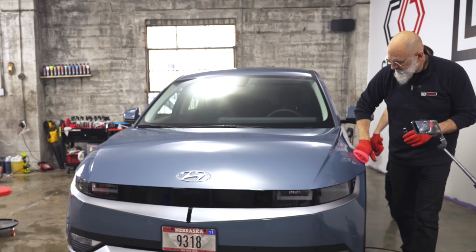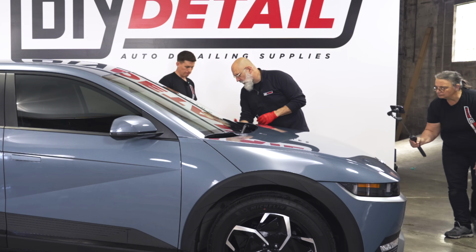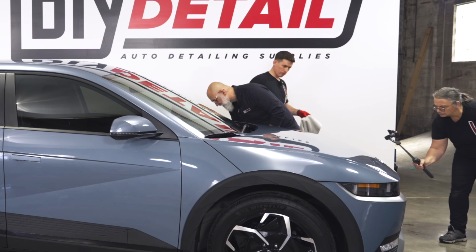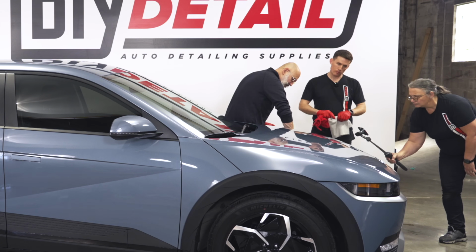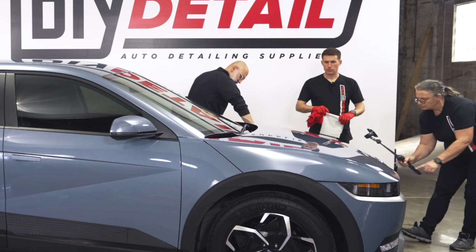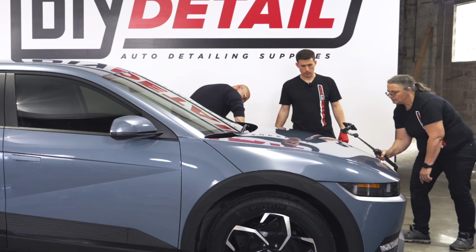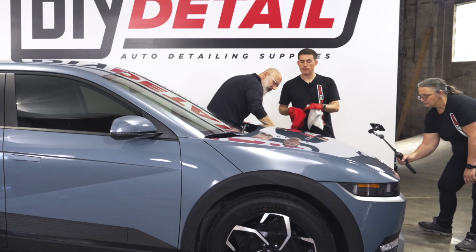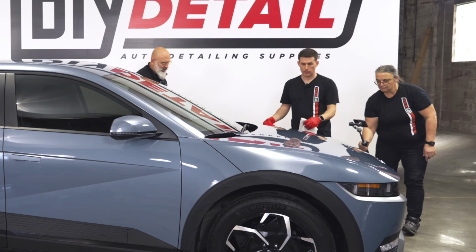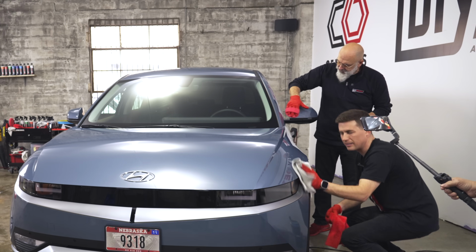And you're purposely going to overlap panels, and I know that about you and how you apply. Definitely. We want to overlap because that overlapping ensures that we haven't missed a spot. And when you're leveling, you also want to overlap. That way there's no spots missed. You can see that rainbowing on the surface, and we're watching for that to evaporate by about 50%. That's called flashing. Boy, I thought that was going to be grabby, and it's ready to wipe. It's ready to level.